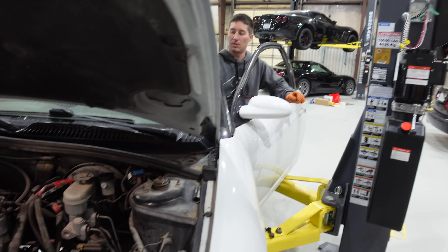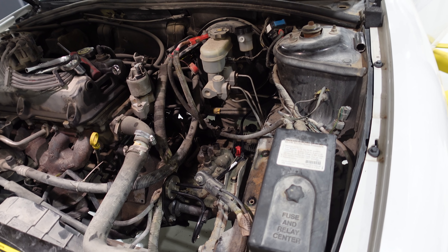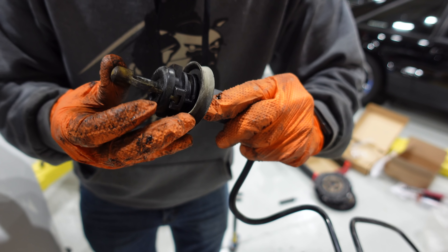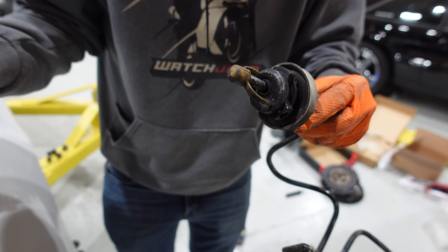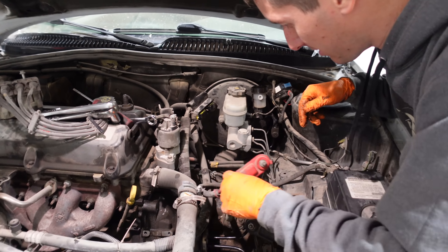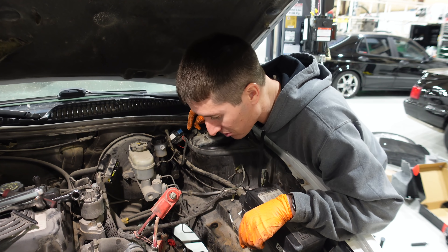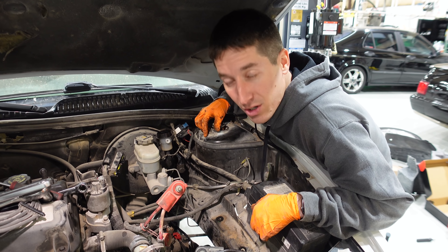Here comes our clutch test — I don't know if it works or not, but we're going to hope and pray that it does. When I pushed on the clutch pedal, there was a huge pop and there was some resistance first. I feel like this breaks on purpose — maybe this was always supposed to be broken and it's just there for shipping, to protect the cylinder itself. There were two big pops. Now we're down to the shifter cables and a couple of connectors — basically just plugging in everything. I've got a reverse indicator on the back of the trans, a speed sensor, and the cables, and we're ready to shove the CVs back in and put everything back in place.